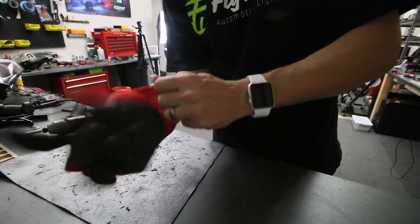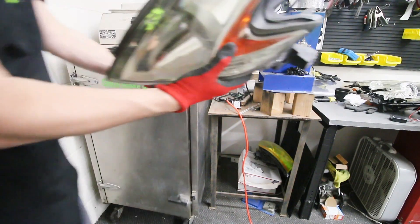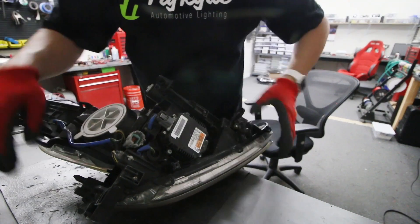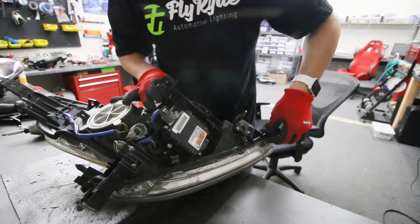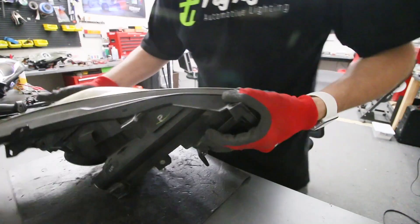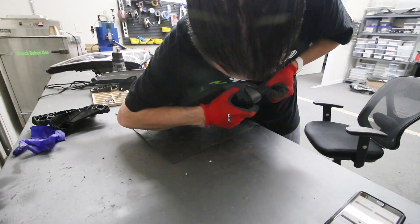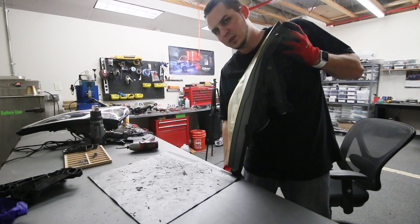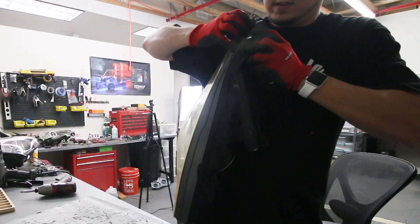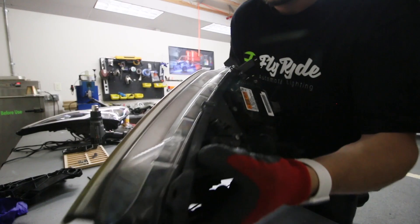Glove up — it's been about eight minutes total, so I'm going to take them out of the oven. Make sure the surface has been cleaned off prior to all of this. We need to get these tabs out of the way, which is why we heat it up long enough — if you start prying before it's ready they'll snap. This is not an easy light to work with because of the large protrusion at one end. One trick: wedge the edge of the light down so the base goes further down, letting you get in and use both hands.